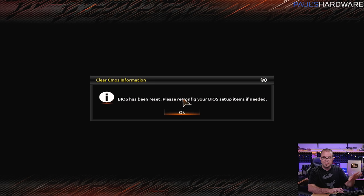I've ejected both drives from my existing functional computer. I'll save my external storage drive for later, and I'm going to plug my USB drive directly into one of the USB ports on the back I/O on this computer. And now I'm actually going to power it on. I've got a mouse and keyboard hooked up, and right after I power it on as it's booting up for the first time — within the first five or ten seconds — I'm going to tap the delete button on the keyboard. That tells the system to go into the UEFI.